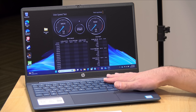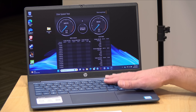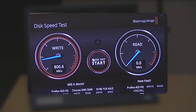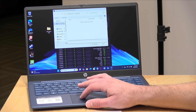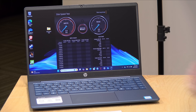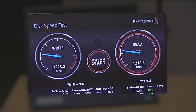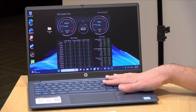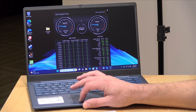As far as storage goes, there's that NVMe slot we mentioned, and we occupied it with a one-terabyte SSD. The built-in storage is a 128GB UFS flash device — slower than an SSD, but not bad; I'm pulling about 800 megabytes per second on both reads and writes. Switching to the NVMe drive gives about 1.2 gigabytes per second — a Samsung drive we installed. I was surprised by how good the storage performance was. Having two storage options also means you could dual boot, putting Windows on one drive and Linux on the other.